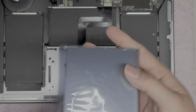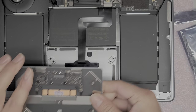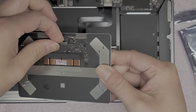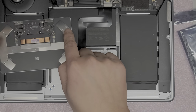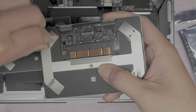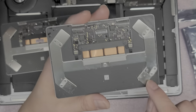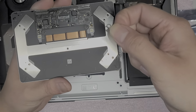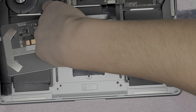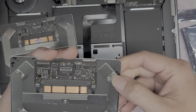We're going to get the new trackpad and cut this open. Take out the new trackpad. We want to transfer over the little washers — make sure the little tab is up too. On these pieces there are little metal washers that we want to remove. If you want, flip it over on your desk because these little washers are super thin and small, and they can drop in.